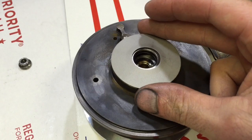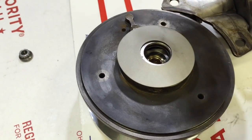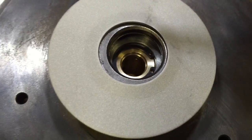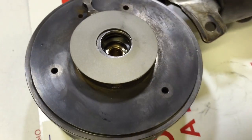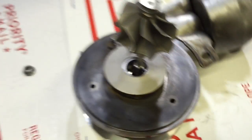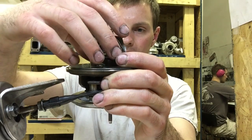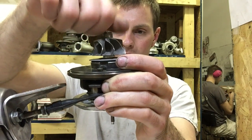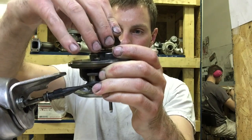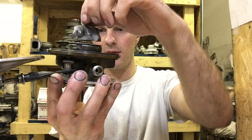Install the heat shield and install the turbine jacket. Keep in mind there is a C-clip in the back of this housing — that was already there before I installed the bearing. This is the shaft installation. Make sure you put plenty of oil on the seal, the shaft area, and the bearing itself.